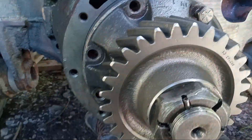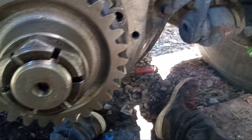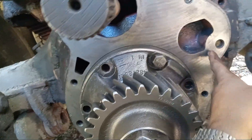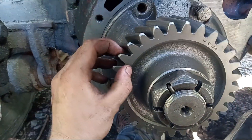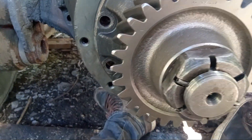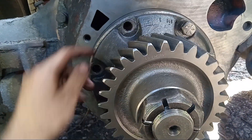I'm putting the speed gear back in and I made a mistake I'm going to have to work double to fix — but it's not complicated. I had put the axles in, and once you put the axles in the differential gear won't spin, and you need it to spin in order to get this in. So I had to remove them again. No big deal — I'll have to scrape off some of the sealant I put on, but that's all right. This thing is heavy as hell.